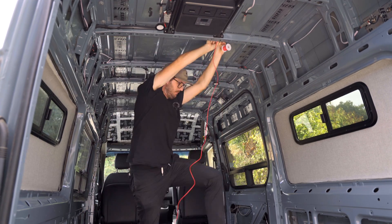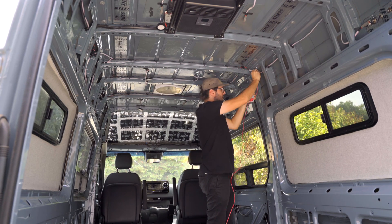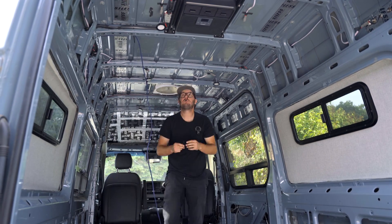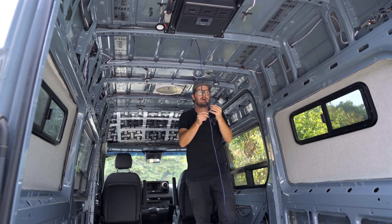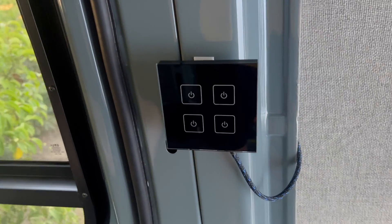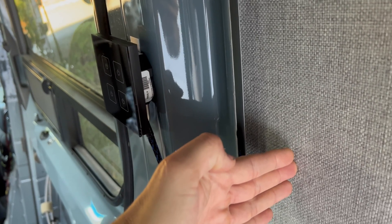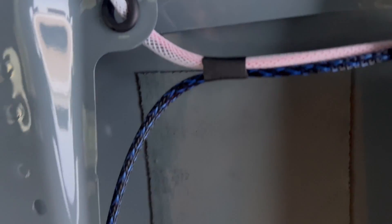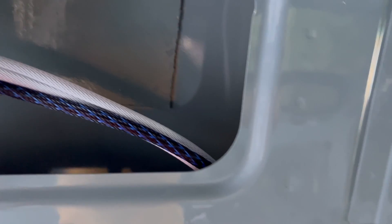Here I'm running the wire for the touch pad that will be on the passenger side of the van. It's really nice not to have to run four zones worth of lighting cables over here to switch them — just one single circuit to power it up. I really like using these runs along the roof supports. With the wing cable ties, it's a great way to pass wires back and forth from one side of the van to the other. This is eventually pretty close to where our main dimmer touch pad will be mounted. I have it stuck on with a 3M command strip temporarily. The trim ring will come to about here, leaving a nice pocket behind the panel for it to be flush mounted. We ran a wire between the two panels and up the C pillar, following the porch light wires until it branches off across the roof support to the other side of the van. It's then nicely labeled and follows the other light wires down the same path to the electrical cabinet.